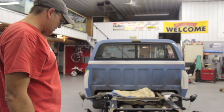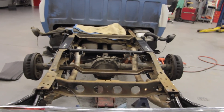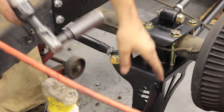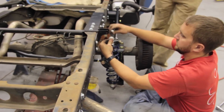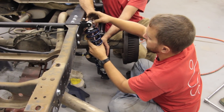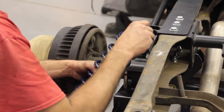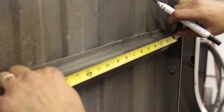Now that all four four-link bars are attached, we're going to put the panhard bar on and then attach the rear coilovers. The panhard bar we provide is also preset, but once your truck is down at ride height you'll want to double-check the distance between your wheel and tire and the outside of the bed. These coilovers don't really care which way they're mounted, but on this truck it's a lot easier to adjust with the knobs facing up. Turn the shock knob all the way in, then back it out to the middle — that's a really good starting point for adjustment.